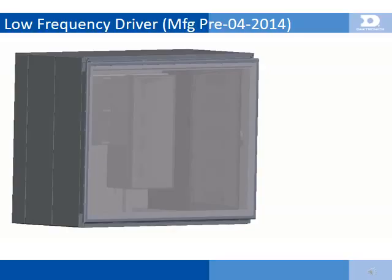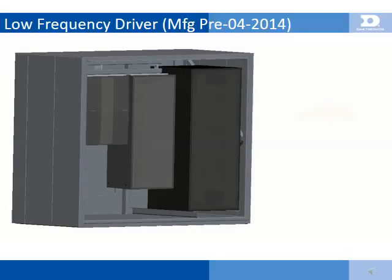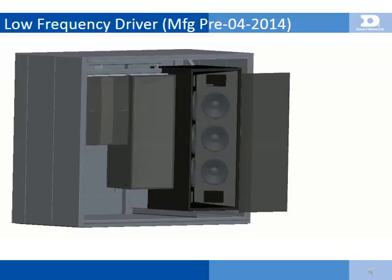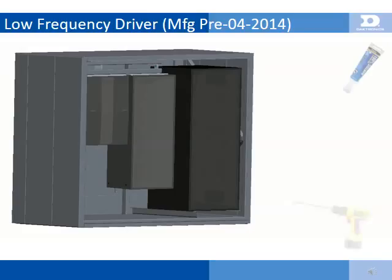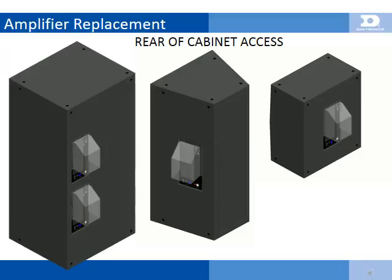Sportsound 1500HD sound systems manufactured prior to April 2014 require service of the low-frequency driver from the front. Access is achieved by removing the mesh frame from the 1500HD cabinet, which requires a 9/16-inch socket to access the bolts that fasten the frame. The low-frequency speaker cabinet grill must also be removed. This grill is weather-sealed with silicone, so it must first be cut with a razor along the perimeter and unscrewed using a No. 2 Phillips screwdriver. Replacing the low-frequency driver requires removing 8 machine screws with a 3/16-inch hex bit or Allen wrench. Using the hex bit mounted on a cordless drill driver will make this much easier. Replace the speaker grill and apply silicone to reseal the perimeter, then replace the 1500HD speaker cabinet mesh.